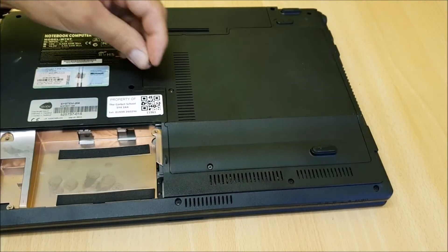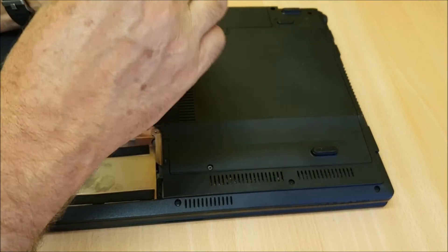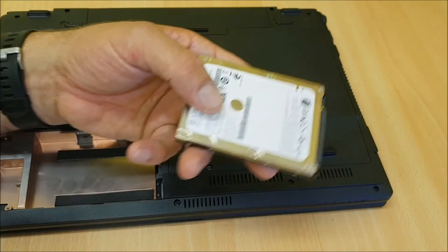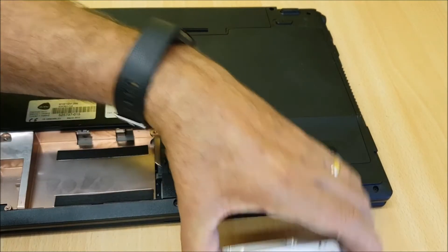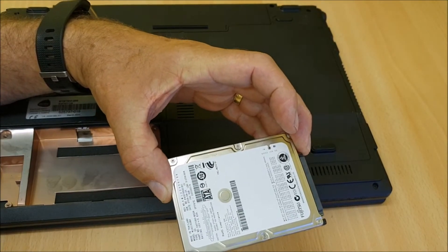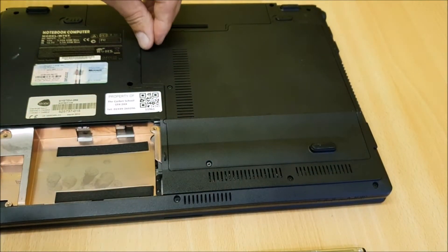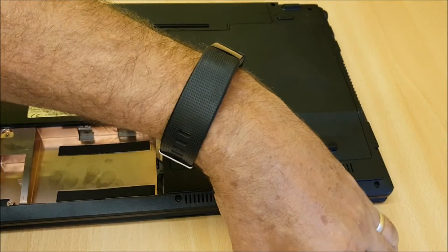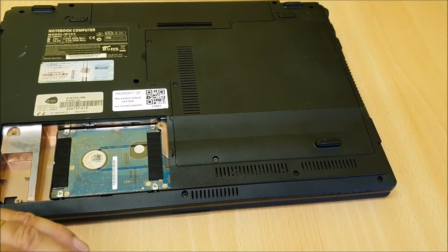Once you've fitted the hard drive and memory, you'll need to reconfigure the system and reload Windows. Before you do anything, if you've got data on your old SATA drive — pictures, documents, anything — save it to another hard drive, a backup drive, or a USB stick depending on how much there is. Then swap the drive over and reprogram the whole system. I've got a tutorial on my channel on how to install Windows on a new hard drive and how to load Windows from a USB stick.